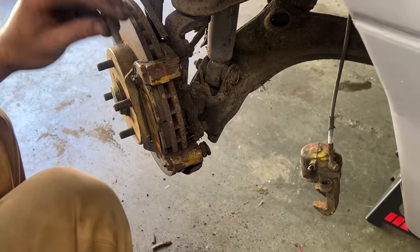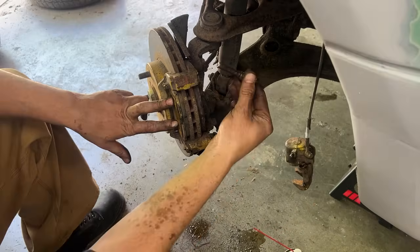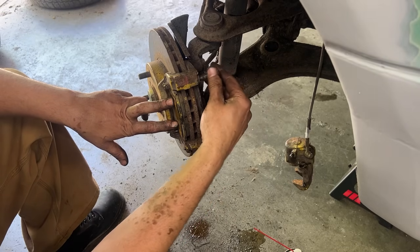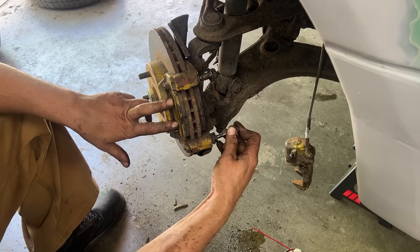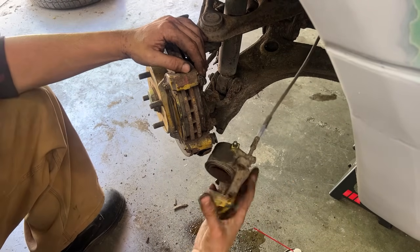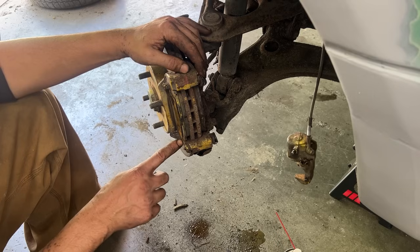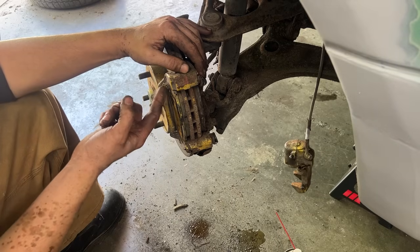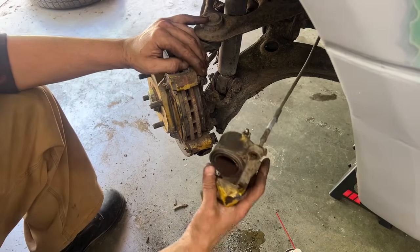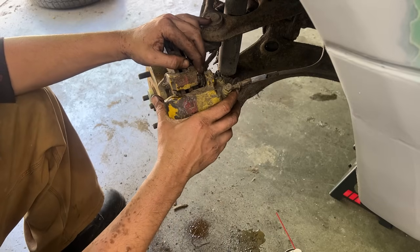And now we're gonna go clean these on the wire wheel. Okay, so I apparently wasn't recording, but we lubricated inside here and we cleaned the pins, of course, so now they travel nice and tight. We are assembling it now with the old pads and everything. We're not lubricating. I was just explaining to Nicola that you need to lubricate here as well, where the pads travel, because there are these stainless steel channels that usually come with the new pads. We'll see if our pads have it.